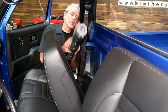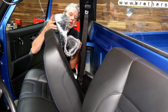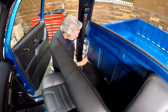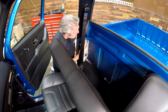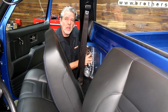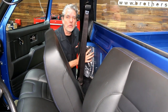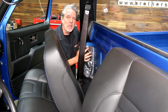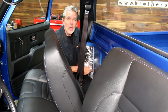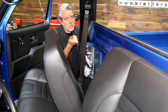Okay, so here's a little tip for you. You go get some sound deadening, get a pretty decent amount, go ahead and roll it on up, and stick it in the corner here before you put in your speaker. The reason you're doing that is because when your speaker's booming, it's creating an air disturbance back here, and that'll reverberate off this corner and might give you some tinny kind of noises or background noises. So we'll put this in here, and that's going to deaden it down and send all of our cool music forward.